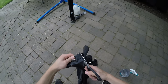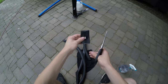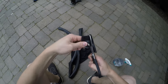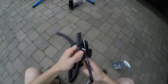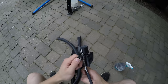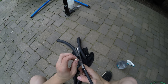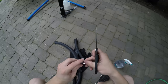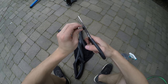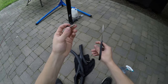This is the step that's going to save you a lot of money and gives you a use for your old tube. Instead of buying fifteen to twenty dollar valves, you can just cut out the old valve from the tube — not extremely close, but a fair amount of the tube around it — to get as close to it as you can without compromising its sealing abilities. Just like that. You can custom shape it depending on the shape of your rim to get a good seal.